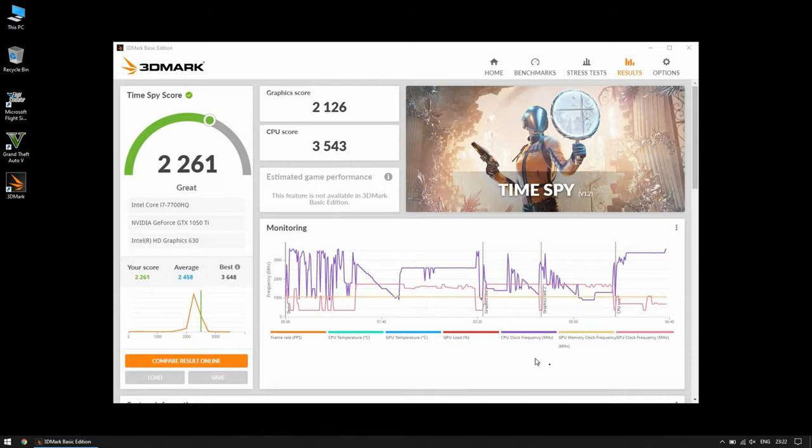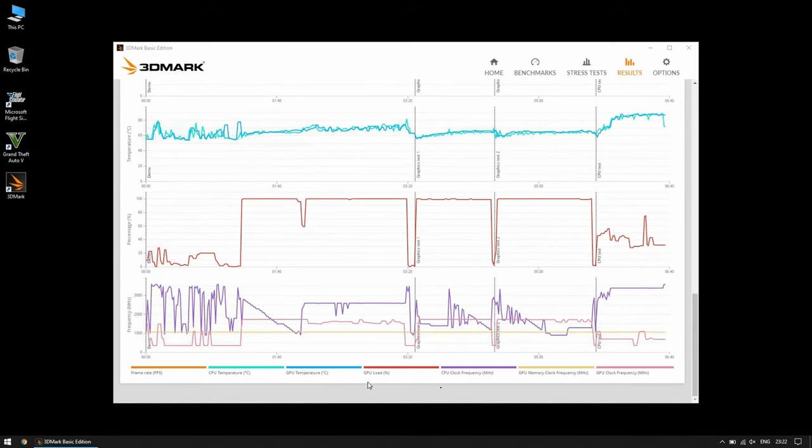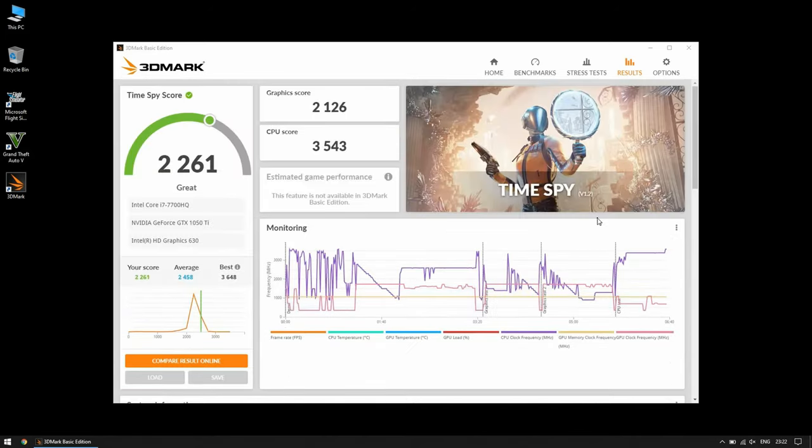The i7-7700HQ has a regular clock of 2.8 GHz and a turbo frequency of 3.8. The 3.8 is where it started, and that's exactly as we would expect, but it should, once the turbo budget is exhausted, fall back to the regular clock. Instead, it got clocked a lot lower multiple times.